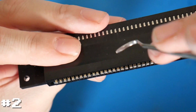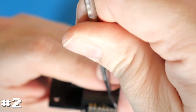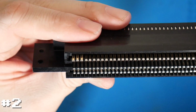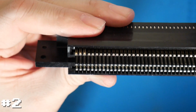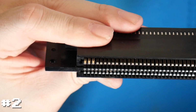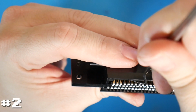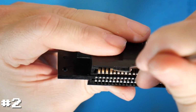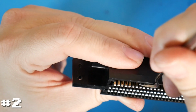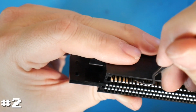Yeah, and these are definitely down. They're down so low that they're actually hard to get. So I'm not sure how well that shows. You can kind of see it here from this angle. I've done the first 3, and we can see the reflection in the video. You can't really see once I turn it, but this way we can see those first 3. So basically that's just showing that they are bent up in order to make better connection. So I'm going to go through and do the rest of these 36 connectors.